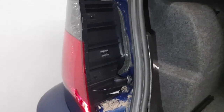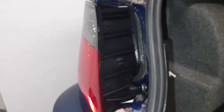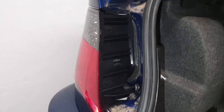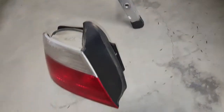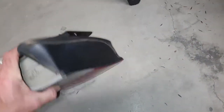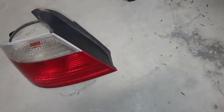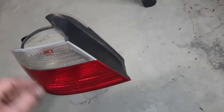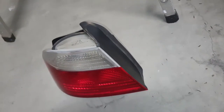You will find that with the new lights you don't get the piece of plastic which goes down the side. Don't forget to remove that off your original lights — this piece here. Be careful with it because it's stuck in with little ridges going all the way down. Be careful when removing it so you don't snap it — just use a plastic lever tool to prise it off.